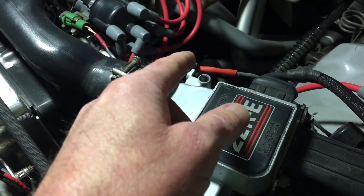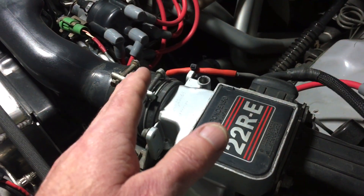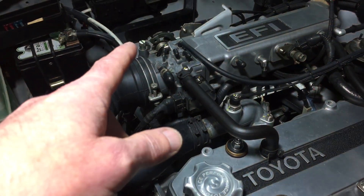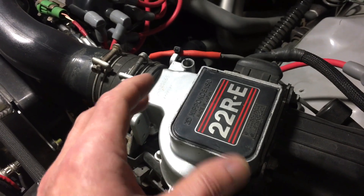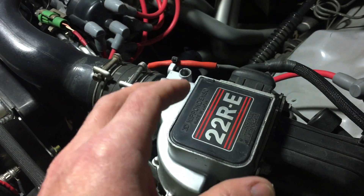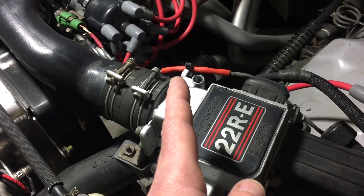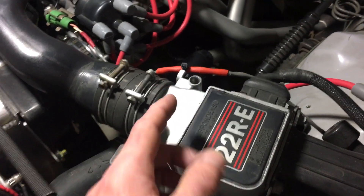If you back that screw up, it's opening a secondary channel which allows some of the air to enter without having an impact on that door. So as you turn the trim screw — it's not really an idle adjustment screw, it's a trim screw for the airflow meter — turning it counterclockwise creates a secondary passage to allow air to fill that vacuum from the motor. What that does in effect is give another channel and reduce the amount of air going past the door, tricking the door into closing a little bit or opening more based on this adjustment.